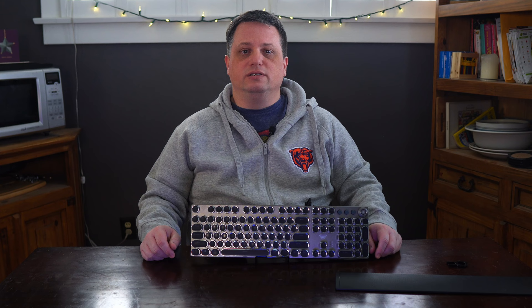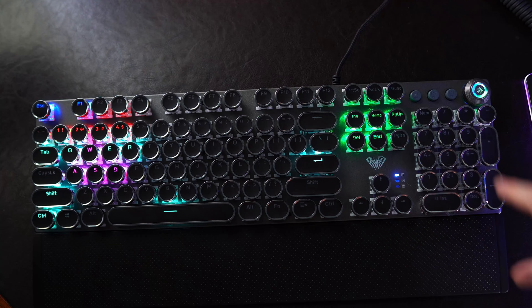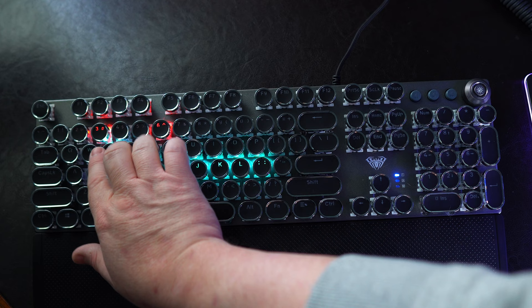You'll know you're in lighting mode if the knob lights up. In addition to 19 lighting modes, the F2088 comes with three lighting presets as well, one for each mode button. You can also make your own presets and assign it to one of these buttons. To make a preset, push and hold one of the mode buttons for three seconds — the entire keyboard will go dark and the lighting knob will start blinking. After that, push the keys you want lit up and then press one of the M buttons to set and confirm.